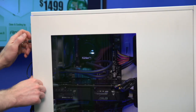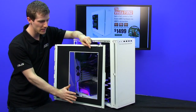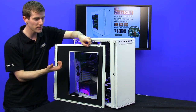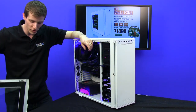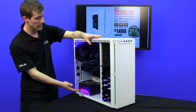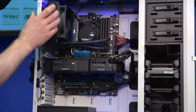As always, we're gonna rip this baby open and see if we can figure out what makes her tick. I promised to show you guys the side panel. What Antec has done is do away with the single piece of noise deadening material and gone with a single piece of Plexi. Rather than a complicated assembly with screws holding on a window, to give you the best of both worlds in terms of looks and silence, they've gone with just two pieces glued together, so you shouldn't have any issues with vibration. Once we get inside, we see a very clean interior layout, with the heart at the core of it — the FX8350 from AMD.